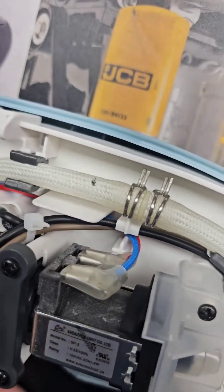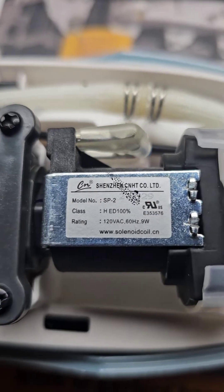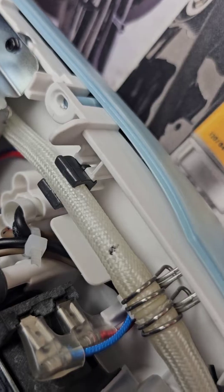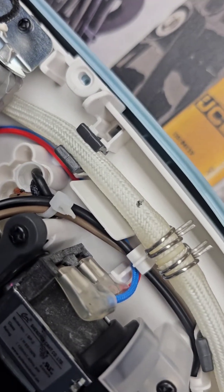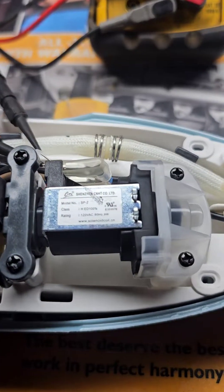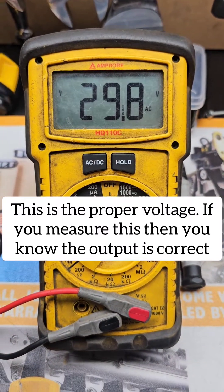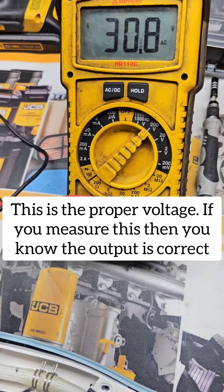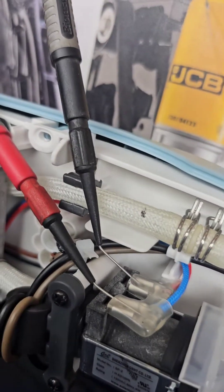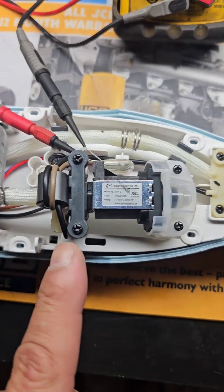I'm going to check for power on these two plugs here. It says this is a 120-volt motor, so I'm going to check the voltage on those pins right there and see if I got 120 going there. So this is a 120 volts AC and I'm getting 30 volts AC. So if that is a little motor, it's not getting enough voltage to pump. I just put these little needle leads on there - most likely what's happening is this pump is not getting the voltage. I think the motor is good.